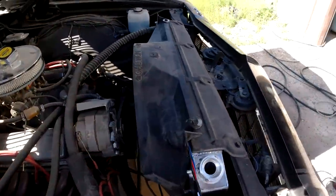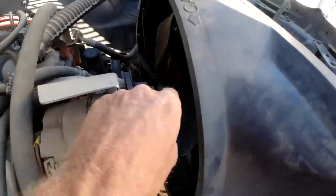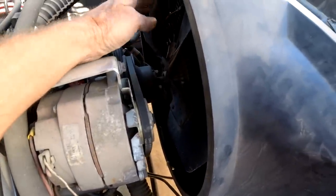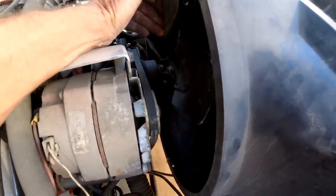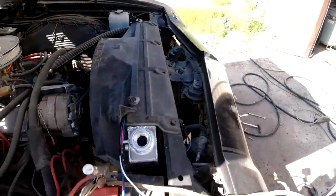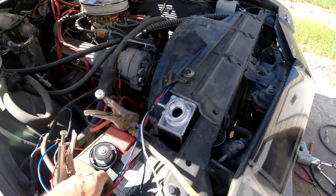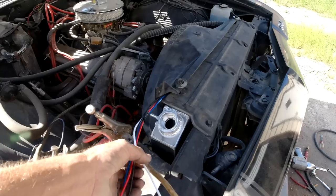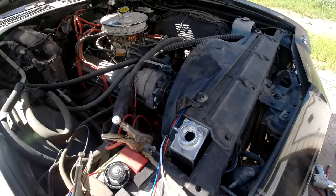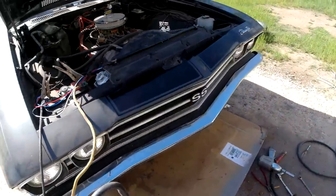Okay. Yeah, those extra fans will give you a little extra protection, because this is a clutch fan since this is an AC car. So in case your clutch goes out and it doesn't spin as fast, or you're stuck in traffic or something, click a switch. So yeah, I'll probably, not right now, but I'll hook up a switch for these two fans. I mean, you could wire it into your temperature and have it come on automatically, but I'd rather turn it off and on manually.